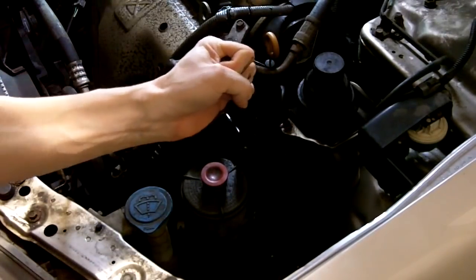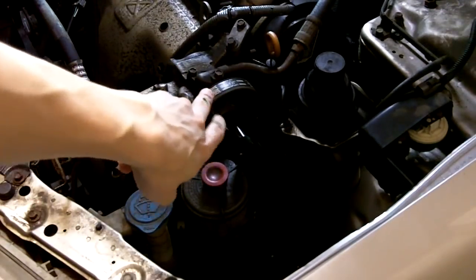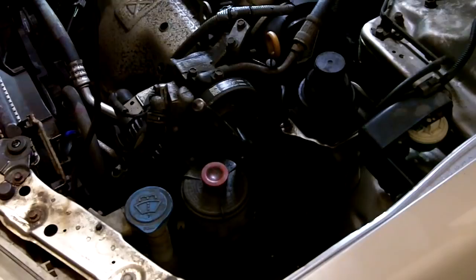That'll turn the distributor rotor. You can remove the rotor after getting the distributor out, but I like to do it now. That way when you're loosening the screw, you don't have to worry about the shaft rotating on you. Another way to turn the shaft to get it lined up is disconnect the connectors from the distributor and just bump the starter to get the rotor into a more favorable position.